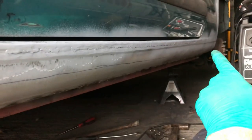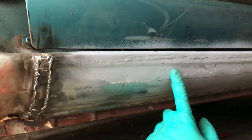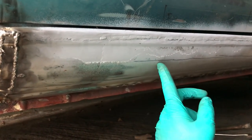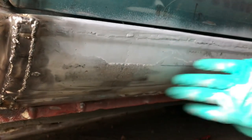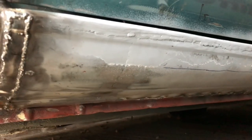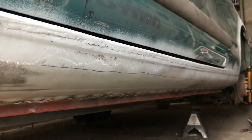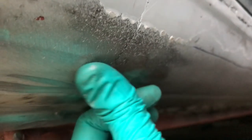I've noticed that what looked like Zintec covering on those steel sections, it isn't - it's like a paint with zinc in it, which isn't great because the solvent reacts with it and then it just becomes a big slimy mess. So in some places when I put a thick coat of the bonder on it, it reacted and came off. If it was proper Zintec it's electrolytically applied so it doesn't react with solvents - it's actually bonded to the metal at an atomic electrical level, basically it doesn't come off. So I'm going to clean this up, take all of that back to bare metal, and give it quite a rough key because the epoxy doesn't like smooth surfaces - it would never stick to that because it's quite polished. Whereas if I really rough that up, the epoxy will stick to it really well.